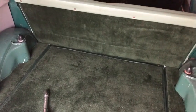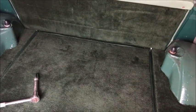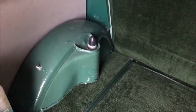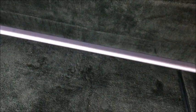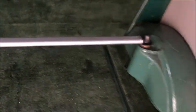Okay, so around the back of the Mini here, essentially all I need to do is lift off the two little rubber grommets. Underneath that is a 9/16 nut on the top of the suspension struts. So let's see them here. So essentially I take the two of those off, and this will slot into place there, and we'll obviously put a washer on there and tighten it back down again, and then these will go back on the top again. It looks fairly OEM as well.